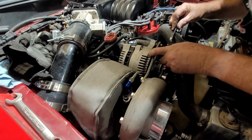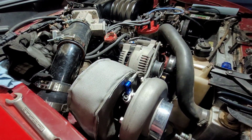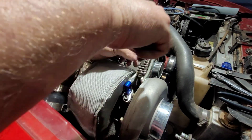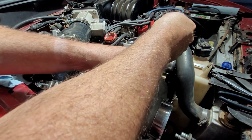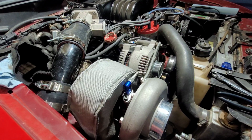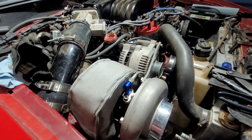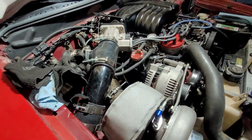Man, I think that is the cat's meow right there, as my dad would say. Tighten this one up. Can't over tighten these guys because they go into aluminum. And we all know aluminum threads are not super good. Dude, let me pop you off and let you take a look at this. We'll even take you off zoom.